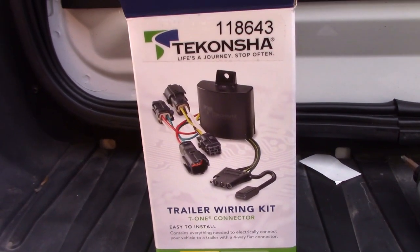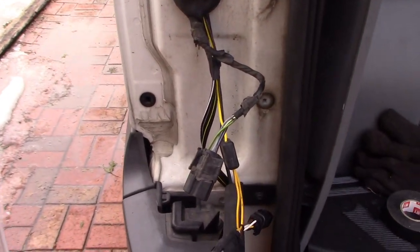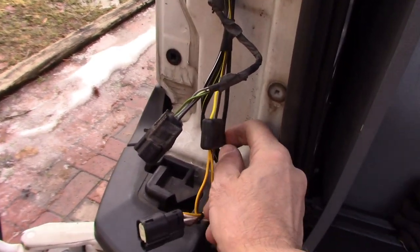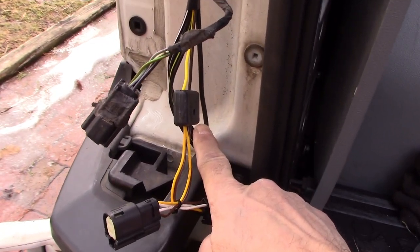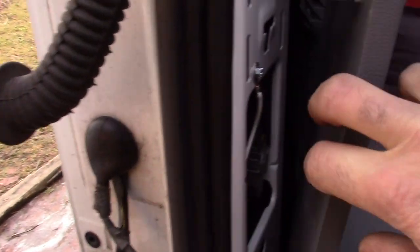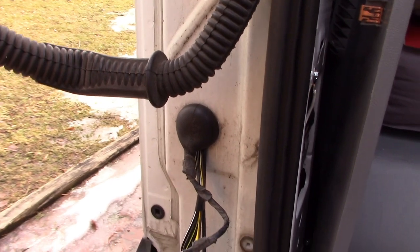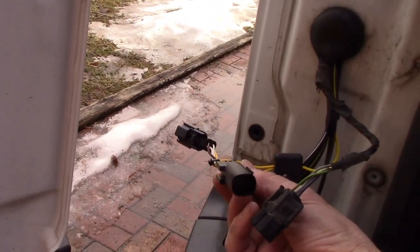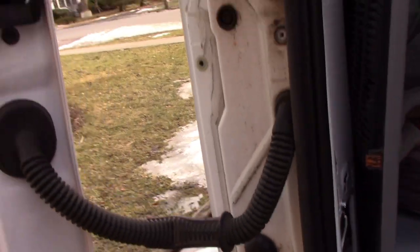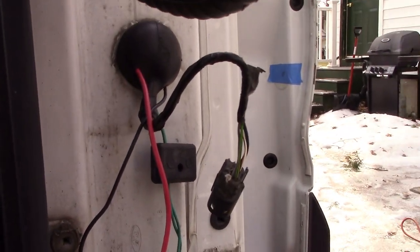This is what I'm wiring in for trailer lighting in this 2015 Transit. First you've got to run a power wire — which I've already done — underneath the chassis from the battery terminal up front, and I went through here to the module which I mounted in there. It comes with sticky tape, grounded, and this is the pigtail. This plugs in between your tail light and the harness, and one wire runs up and over the top and down this side of the pillar and out to hook up to this side of the light.